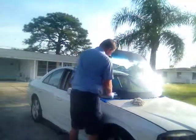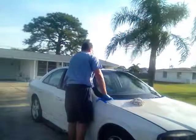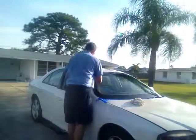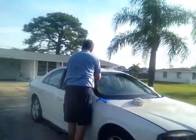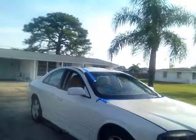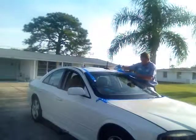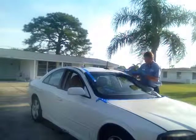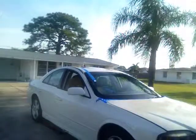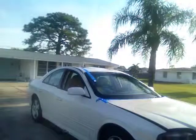If you've ever done a Lincoln LS, then you know that the bead along the bottom follows a very unusual pattern. There are also foam blocks to stabilize the height that the factory uses, and sound-deadening foam. If you don't get the windshield set correctly — if you come in early or high, or if you apply the urethane to the glass and come in wrong — you could actually swipe the bead right off of the pinch weld. Maybe get it hung up on the sound-deadening foam, thus interfering with the way the factory intended for it to be installed.